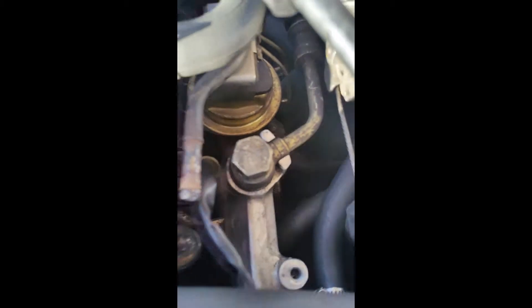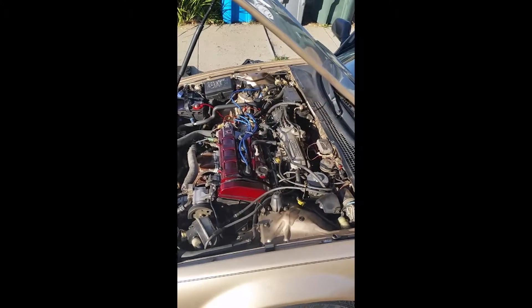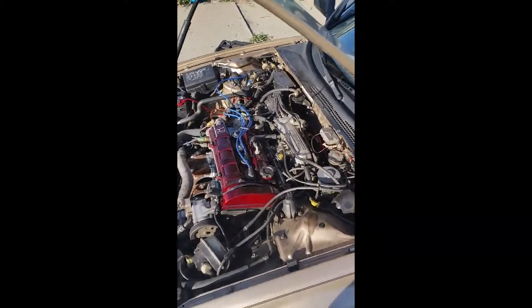Everything is back on — got my hoses, the right one going to the right one, and the connection is back on. I didn't put the covers on yet because I wanted to turn the key over and pressurize it and make sure I'm not leaking from anywhere — which I'm not. The banjo is not leaking and the injectors are not leaking from the fuel rail, so that means it's good. I think the first turnover will still have fuel in the cylinders from the last injectors, so I don't think it's going to start up exactly perfect this time.